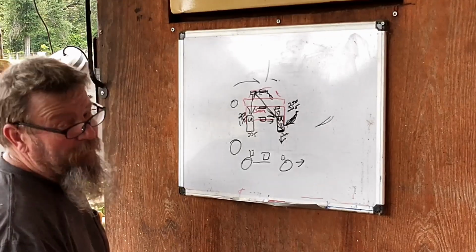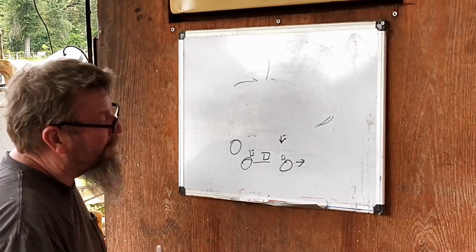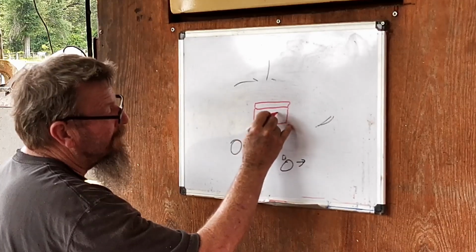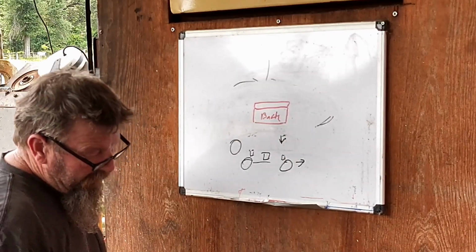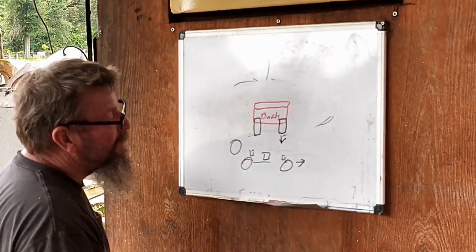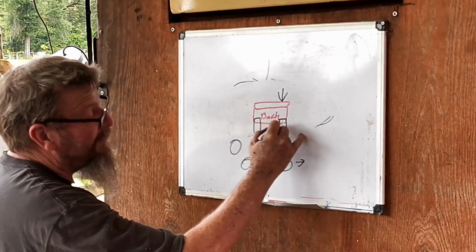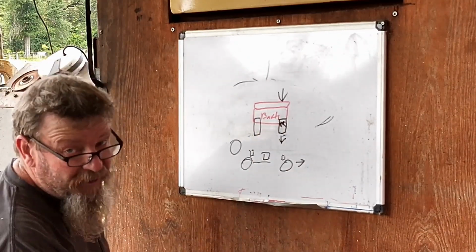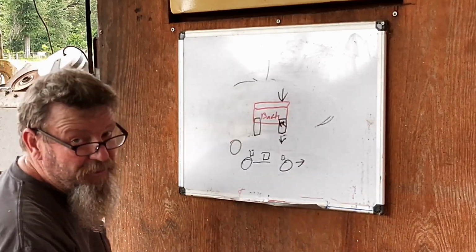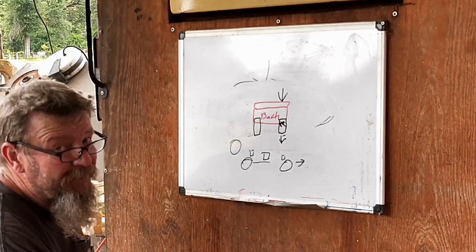So really, in review, if you're looking for side bite, side bite is just pushing down on the right side tires. I was going to say right rear, but you can push down on that, and then if it starts to push, you can push down on your right front, and you've got a car that'll rail around there.